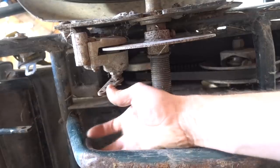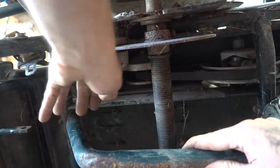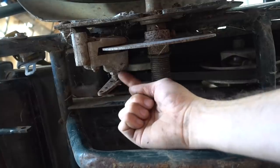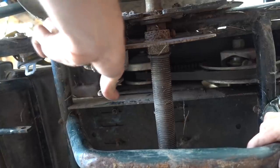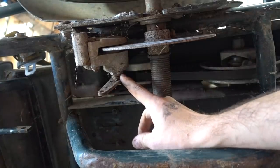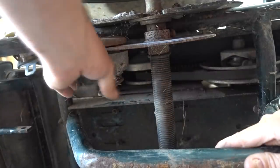No, I don't think I've ever messed with brakes like this. This is like a lawnmower braking system, and I just remember replacing pads as far as I'm aware. But I think how this works is this bolt goes into like another bolt, basically, and it allows it to spin, you know, that small little bit. So what I'm thinking is if I tighten this nut, it'll pull the whole situation up, and then the brake pad will finally come in contact with this rotor here.